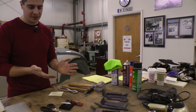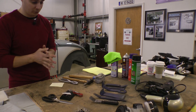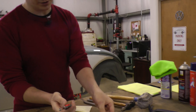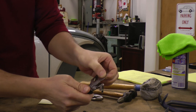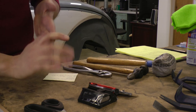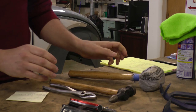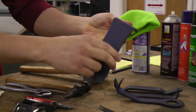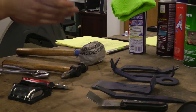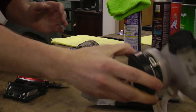Here are some tools laid out that you can pick up from a local hardware store or even a dollar store. A good pair of scissors, of course. I like this razor — you're going to need a whole box because they get dull fast. This one just flips open to swap blades quickly. A pair of pliers, a general hammer, a rubber mallet, and these high-impact plastic tools used to remove body molding and door panels. This curved tool is great for tucking the headliner behind the pillars — VW actually used a tool very similar to this.